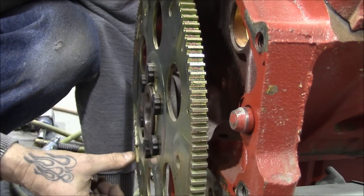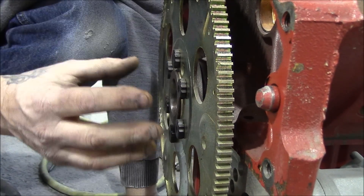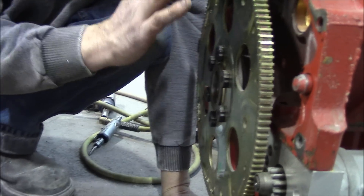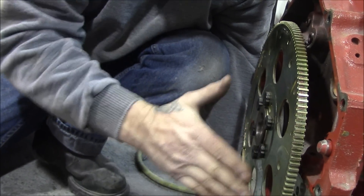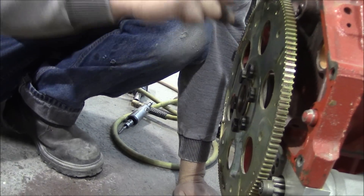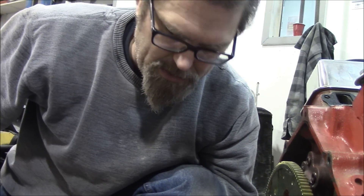You just pull that torque converter forward - it'll slide forward and line right up with these holes. That was the problem we had. The actual distance it's going to pull forward is basically the width of this inside in the crankshaft - that's where it's going to push into. Then you put your bolts in - get your first one in kind of hand tight, do your next one, go around. Don't just torque one tight immediately - if you tighten one tight, you're flexing and bending it. Tighten it a little bit until it's snug, go to the next one, then get your torque wrench and torque them all down.